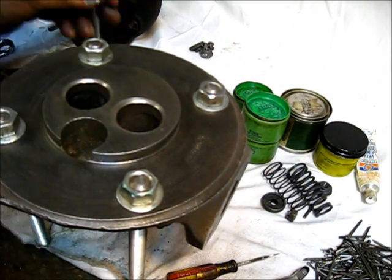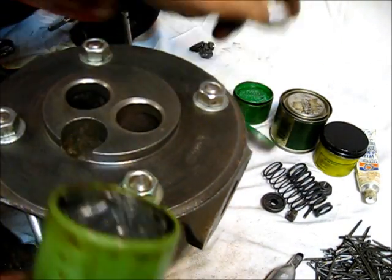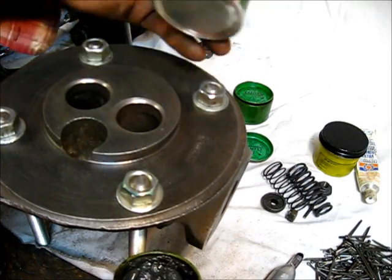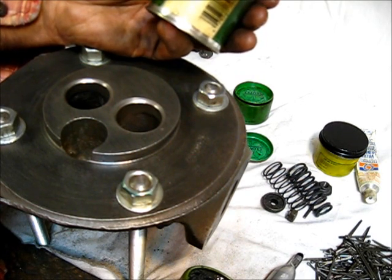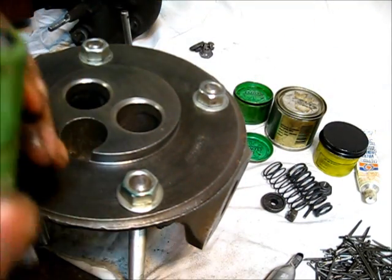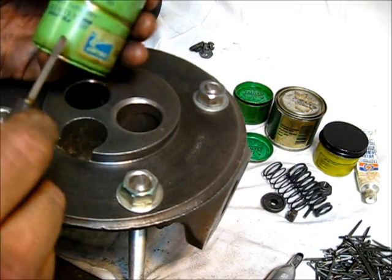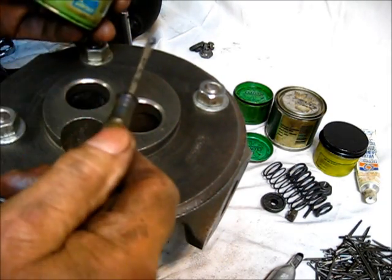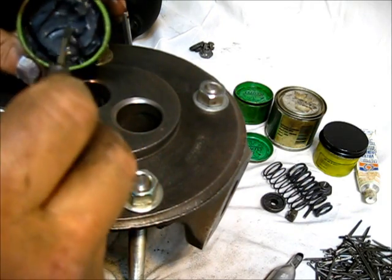Seating valves without oil is not something I necessarily recommend, but some people just do it. The valve grinding compound I was just reading about — this is Clover, the Loctite Clover brand. This one is 280 grit, which is not all that fine. This other one is also the Clover brand but on Fel-Pro packaging. It just says 'fine' and if you look at it, it's really fine — I'd say that's around 1000 grit or something.